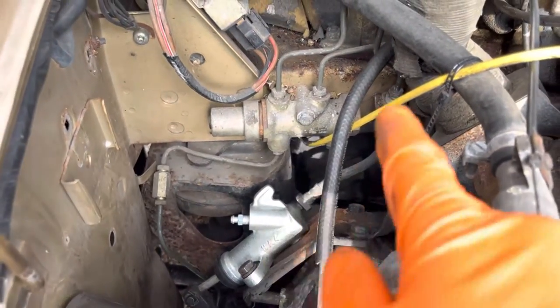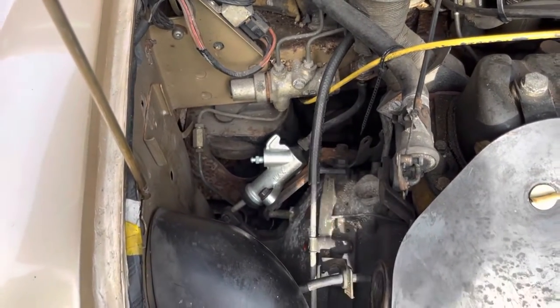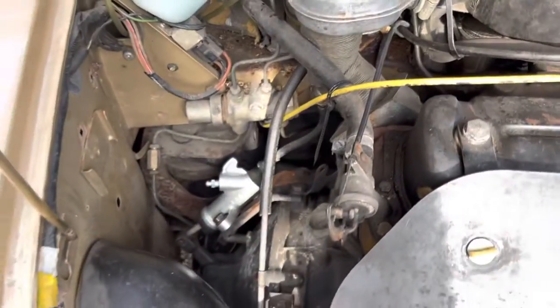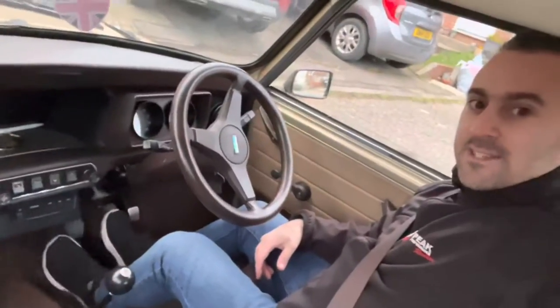It looks pretty! Everything's all done up. We'll likely need to give this a clutch bleed. Let's start it up and see — well, you'll see I'm in the car now and the clutch feel is beautiful, better than ever before. The slave cylinder replacement has made the world of difference. A heads up: when you bleed, you need to do both the brake master cylinder reservoir and the clutch fluid level — keep it nice and full. Syringe out the old fluid, put fresh fluid in, keep topped up as you bleed.